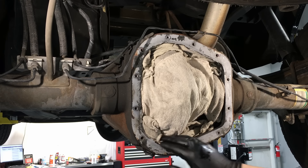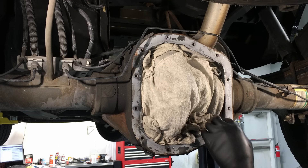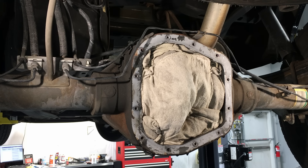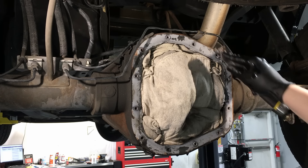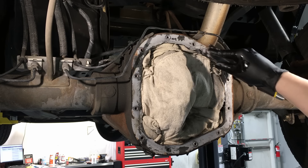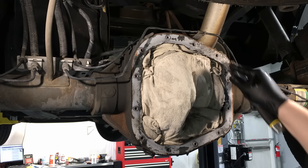After the rest of the fluid drips down to the sump we'll do another wipe-out of the case, but in the meantime we can get the outside cleaned up and ready to go back together. The outside is going to have a lot of excess sealant, as you can see here. Before you get the grinding disc over it, I like to get the bulk of that old sealant off first — it makes the grinding step much, much faster.